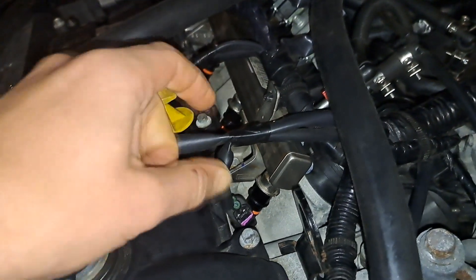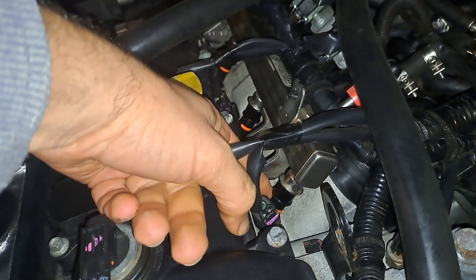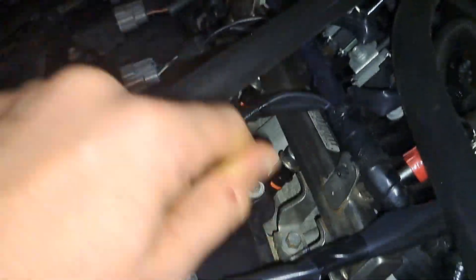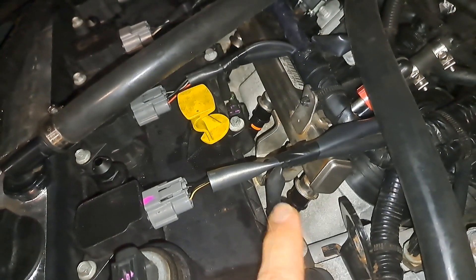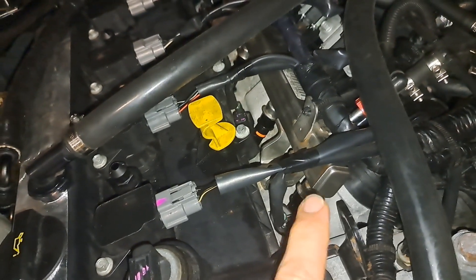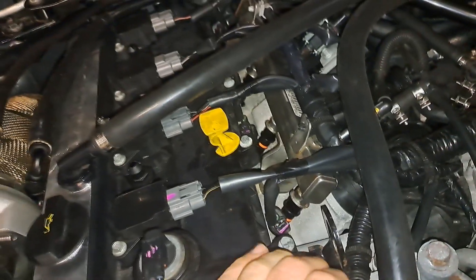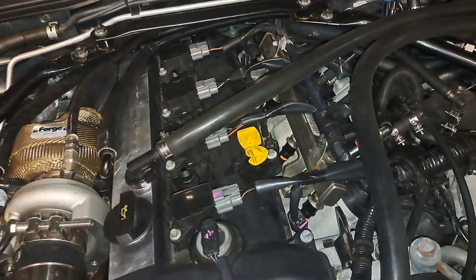You can have little metal clips to hold the top hat to the injector — they move a little bit but I haven't had any leaking. The whole rail and all injectors are held down by two bolts, so no problems there. You need the top hats to make these work and bring them to the same size as the original injectors, and you need the bigger blue o-rings on top of the top hats to make them fit into the fuel rail. Don't leave it to the last minute at the tuner — you might not have the parts with you.